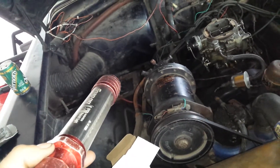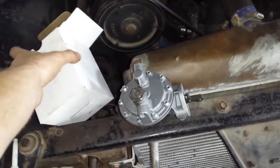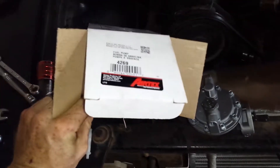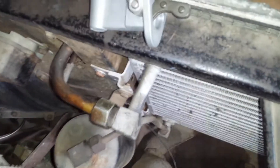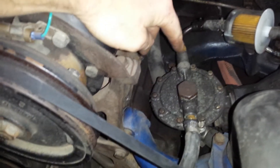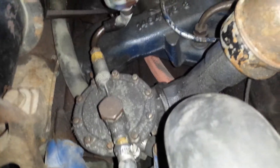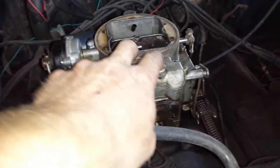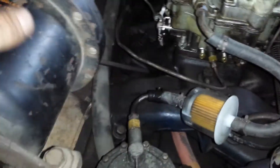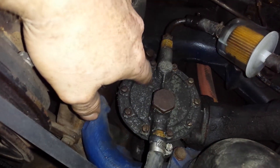It's more than just a battery issue now - something inside is corroded. So I broke down and got a new pump. This is the Airtex, and I tried everything to get it to work again. I peeled this off and poked through to see if I could get all the way through - nothing in there. I replaced the filter, cleaned the carburetor all apart, and I'm still not getting any fuel pump through to the filter. I took this out and cleaned that screen.